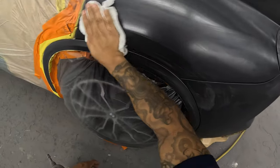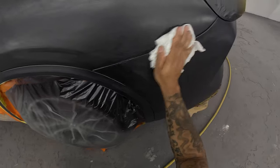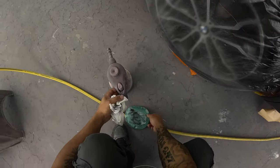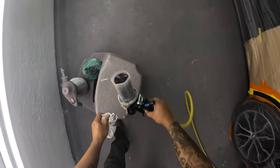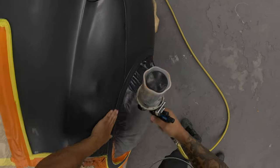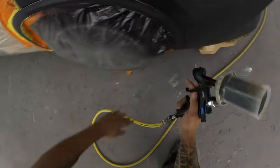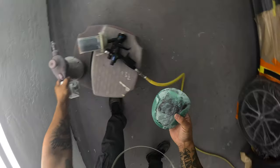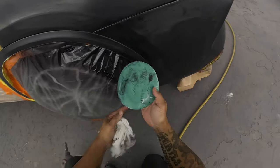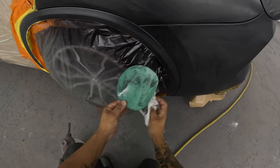With the first color being so off — not matching at all — and then all these scratches and sanding, I come back with the correct color, still staying nothing above that body line, right on that body line. Just watch how in the end it comes out smooth and perfect. Learning to use those body lines, working off those body lines on cars — that'll save you a lot of time, a lot of material, and in return make you a lot of money if you're on flat rate commission. Learn how to work and paint off those body lines.